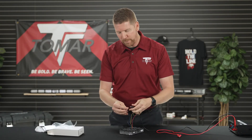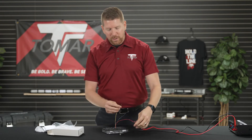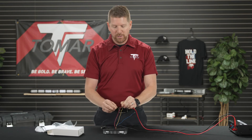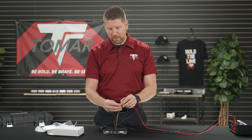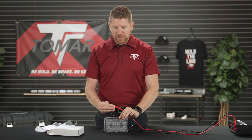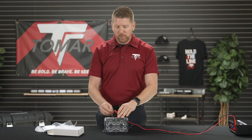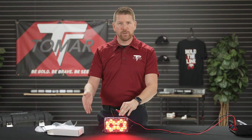In this case I'm going to hook up my power clip to ground and my power clip to positive. To get into programming mode, the yellow and the red wire need to be energized at the same time. This is going to tell the lamp that we are programming the red wire, which is our primary function. We're going to tap the yellow over to the power and then turn on the power supply, and because these are both held on at the same time we get a visual notification of three flashes — this is telling the lamp that we are now in programming mode for the primary flash pattern. We can go ahead and release the yellow wire.